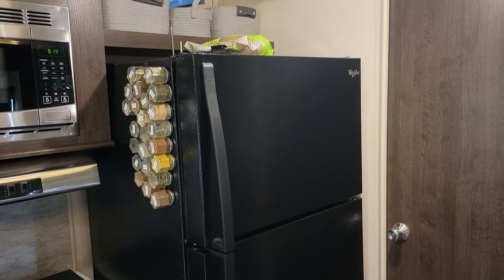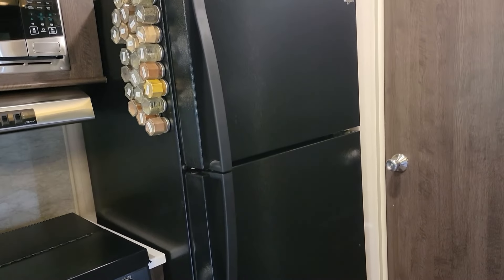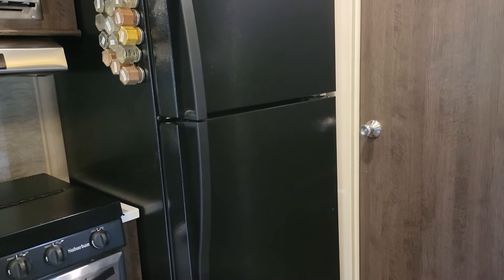It's a bad idea to have a 120-volt AC fridge inside something that's meant to go on the road. This is a big trailer — maybe people didn't think we'd be taking it on the road as much as we do, but they were wrong. The problem we had was it stopped cooling. The compressor ran and got warm, the interior light came on, but nothing ever got cold. We let it go for a week or two to figure out our solution.